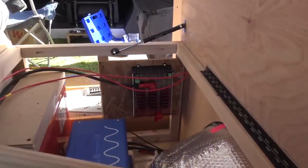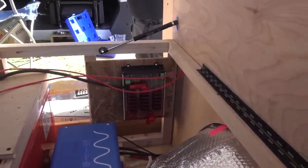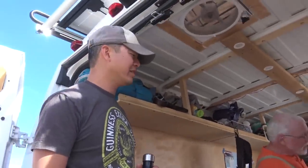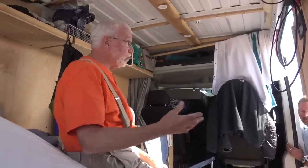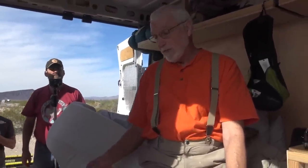And so now he's got the 100, that's 180, right? Yeah. It's a little over 180, just because the alternator is 100. So the way I size mine, my alternator is 140 amps. Okay. So I have a CVSR 140 in my van. Good. Yeah. They're not cheap, but what they do is they sense both sides.